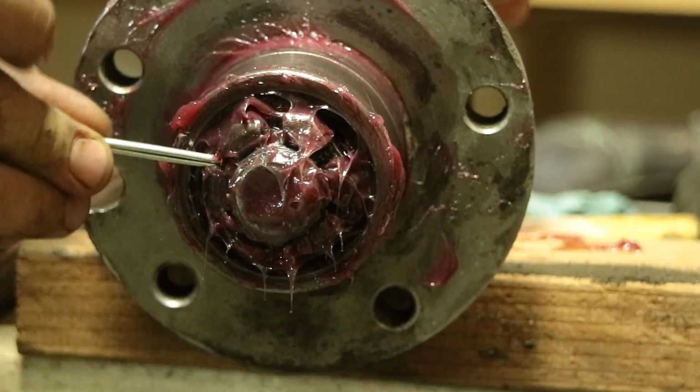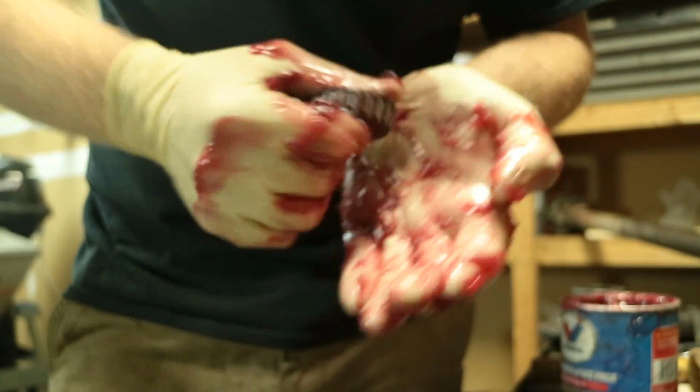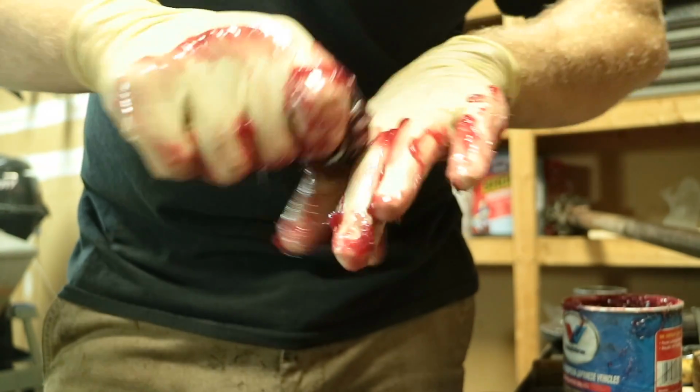Now you can go to your local auto parts and pick up grease, and I'll leave that down below in the description too if you guys want to go check that out. So like I said, I took apart my bearing buddies and I repacked them. I made sure that I got all the old grease out of the bearing by putting a dab of grease in my hand and just pushing the bearing down on top of that grease, and you can see all the old grease come off of it.